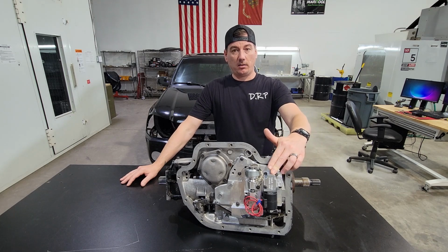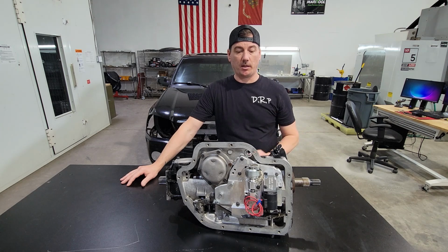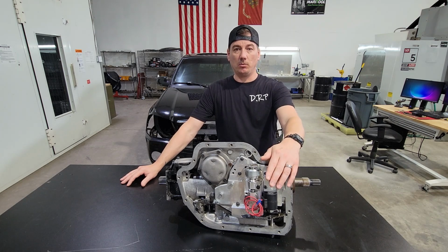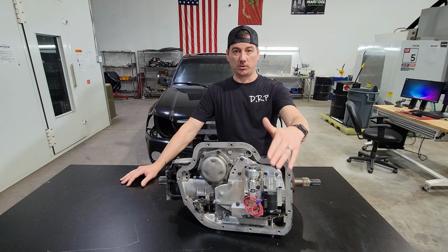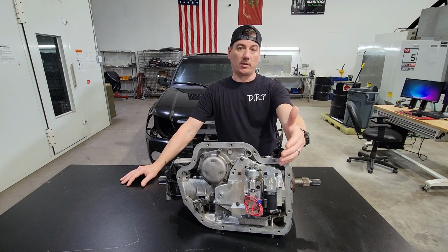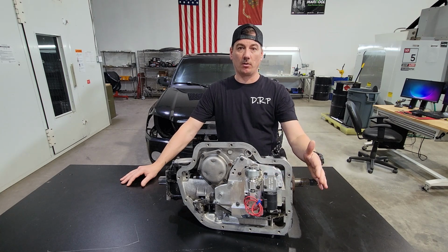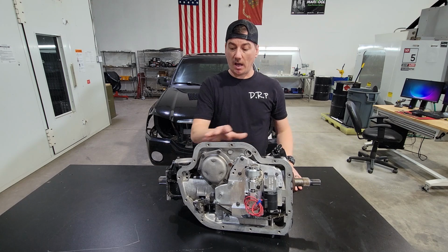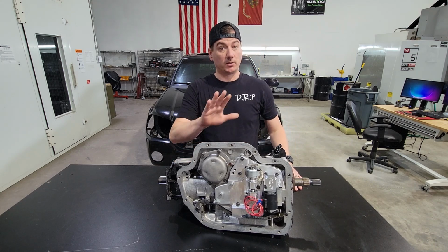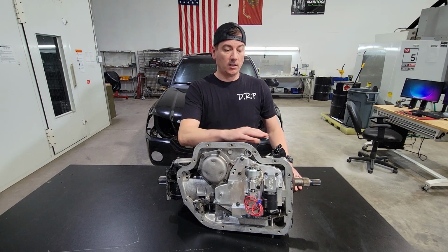When we're doing that, okay, and you're on the starting line, and you're staging on the trans brake, you can make this do several different things to control converter feed fluid. What we're doing, we're on the trans brake, we're cutting fluid off, right? Stopping fluid from filling that converter. Okay, you could still have an external dump. You don't need it on certain things, but you could still have one. So we're not really worried about that.